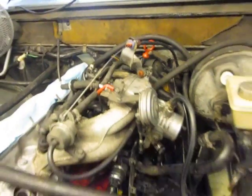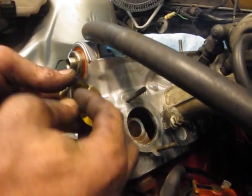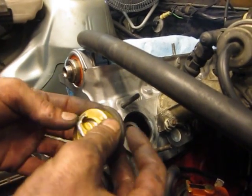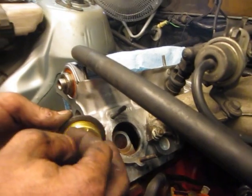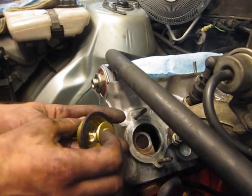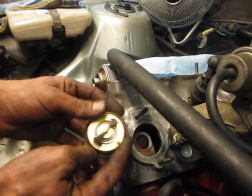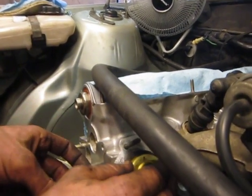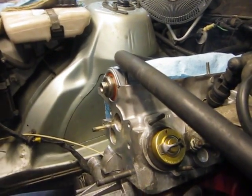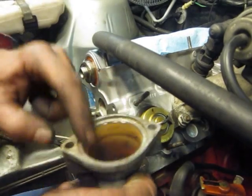This would be a good time to go ahead and put in your thermostat and the housing. This thermostat has a seal on it with a groove — go ahead and put the seal on. This is an air valve — that's for ventilation, an air vent. There's only one way this thermostat goes in on the 240s; you can't put it in backwards, but you can put it upside down. Remember that this has to be on the top — air rises. That's going to be your seal for this — there's no seal around here, the seal fits in here.